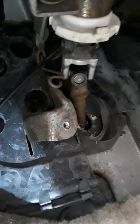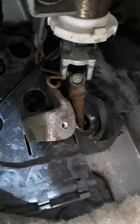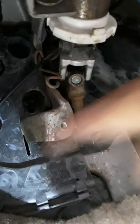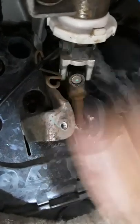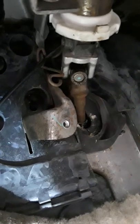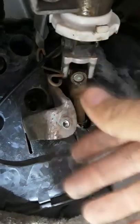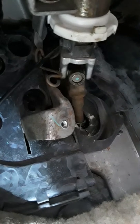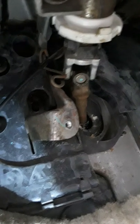But you live, you learn. Hopefully this will save you guys a bunch of time. Just take the wires off, the cable off both ends, drop the pedal. Actually, you don't have to take the throttle cable off. You don't have to take anything off. Take nothing off. Just take the motor off and see if that gear is broken. If that gear is broken, replace the gear — and it will save you five hours. Well, like ten for me.